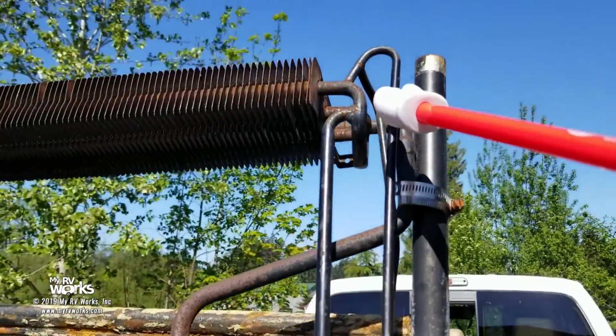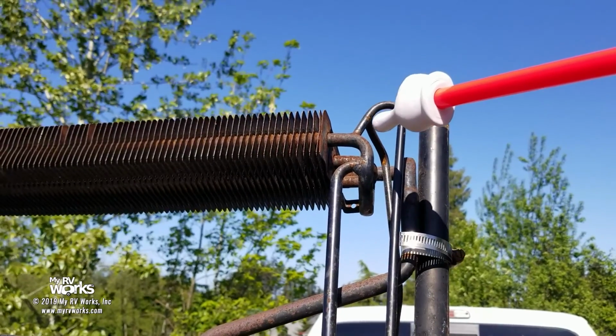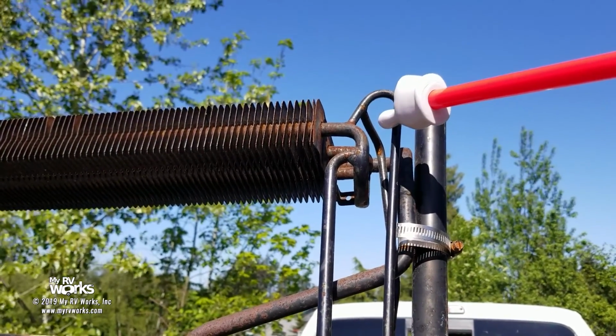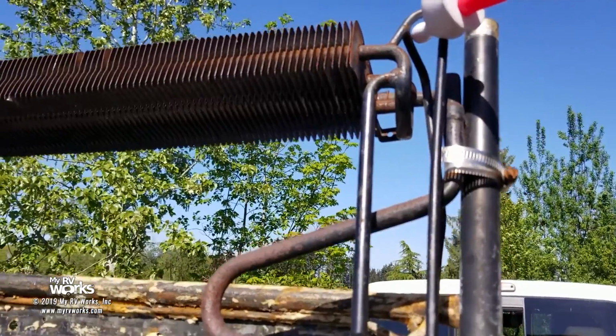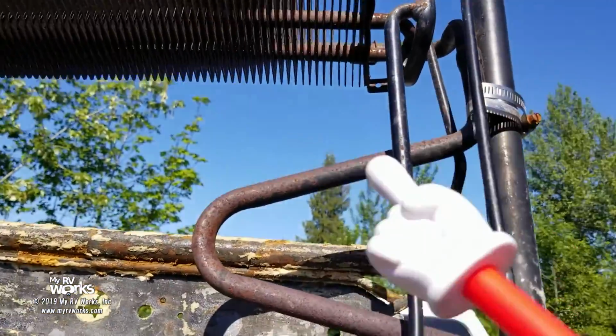Okay, and where are we at? He's going to join in with the ammonia at this point. So here's where the hydrogen and the ammonia join. Hydrogen being a gas at this point, always. Ammonia being a liquid at this point. Okay, so we have liquid ammonia and a hydrogen gas. They're in a small tube. Now that's important that they're in a small tube.